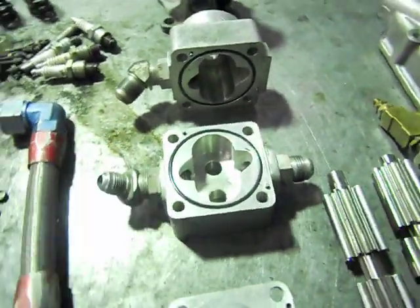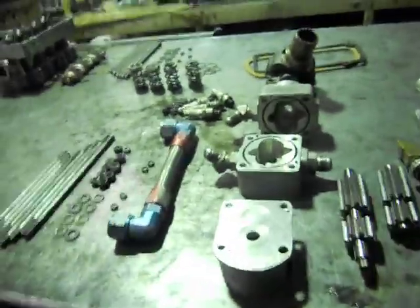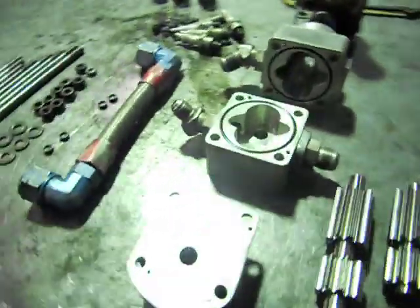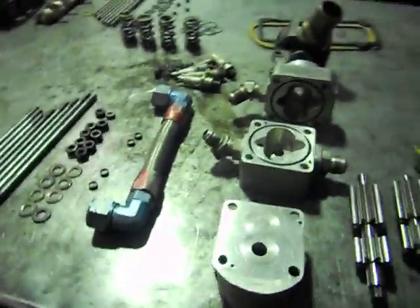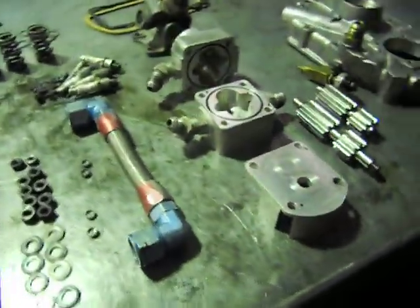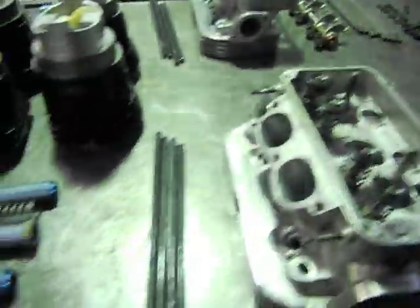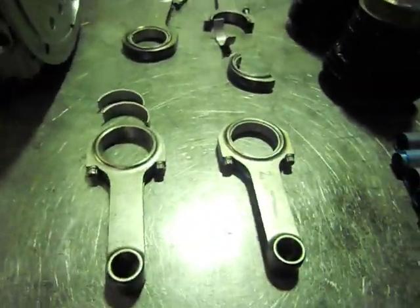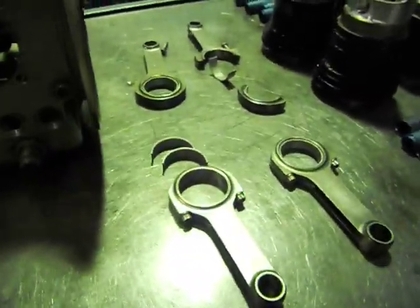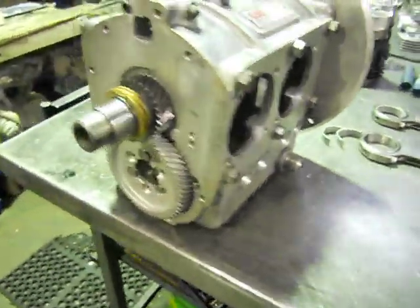So what we think happened: it ran out of oil pressure because of the pump, which in turn spun all the bearings and put all that melted metal — tiny bits of aluminium and steel from the backs of the bearings — right through the oil pump again, which just accentuated the problem and took out everything else.